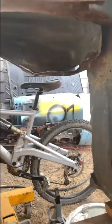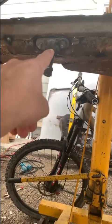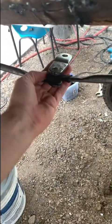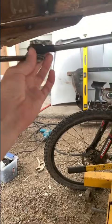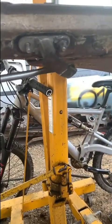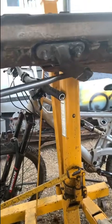I don't know yet, but I do have to maintain this mounting bracket and that mounting bracket for the wipers. What I've got mocked up so far is the linkage off the 2006 Charger. This hooks up to that motor. There is room for me to mount the motor there. I do have to make a mounting bracket, but you can see we've got some movement there.